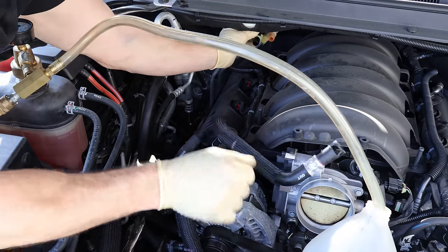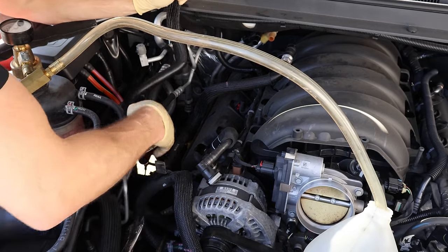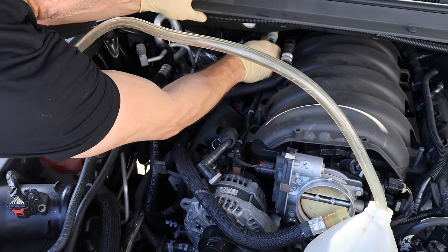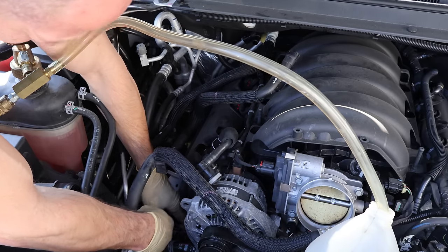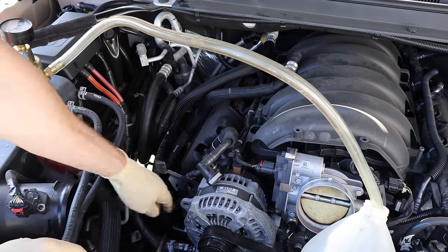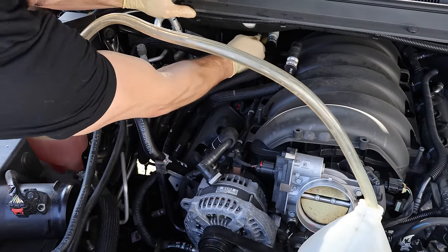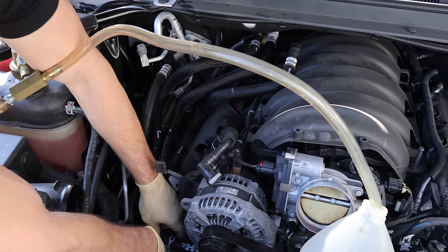To properly use these connectors, we're going to pull the old plastic off of them. You can clip them back on — take the old plastic off and they just snap right on instead of trying to line up the holes with the little plastic tabs. We'll make sure we've got the right one going in the right spot. The two ends are different colors, but we still want to make sure. Put it on there and tug on it a little bit to make sure it's locked in. Wiggle our old hose off and slip our new one on — that was the easy one.